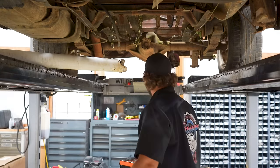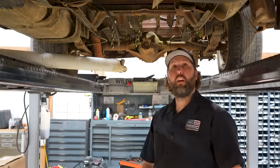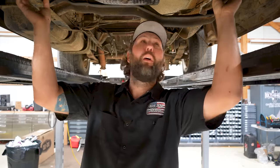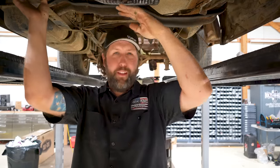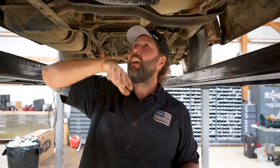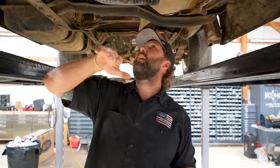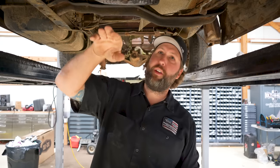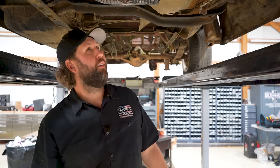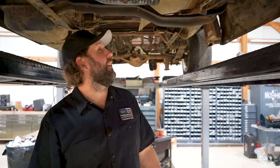Yeah, that's pretty good still. So now I'm gonna work on this cross member here. I'm gonna run a ratchet strap across here. I'll show you when I get to that point, but we can suspend this on that strap, and when we go to pull the engine out, it acts like a sling, and it'll move and give us some freedom, and typically it'll slide right off the tail shaft to come out, and it's gonna prevent us from being down here with jacks and things like that while we're up front and just giving her the onions.